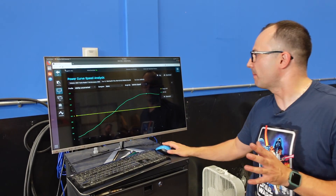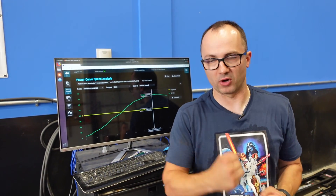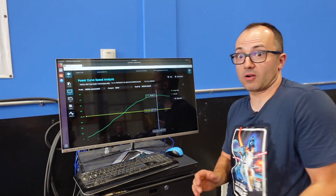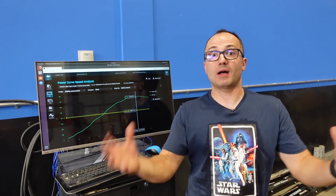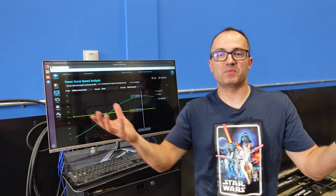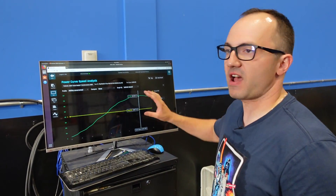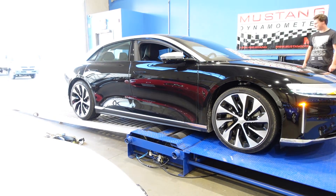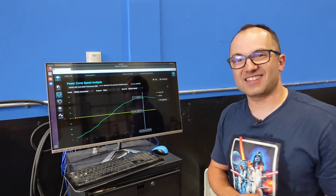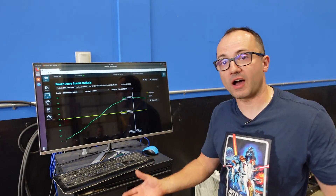So you can probably add 50 to 70 horsepower into the peak numbers. That's based on what we see on gas-powered cars when we put them into neutral. The other thing is that our dyno is a little stingy — it's a Mustang dyno, and compared to a Dynojet it reads about 14% low. Which one's the actual absolute accurate standard? That's still up for debate because manufacturers measure power output at the motor, not at the wheels. Given the fact that we have probably at least 50 horsepower of load loss, and we don't have this car at full charge — it's about 75% charge — and our dyno reads a little bit on the low side, I think that the 800 horsepower this car is rated at is probably quite accurate, and maybe even a little underrated depending on which dyno you're on.